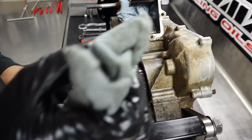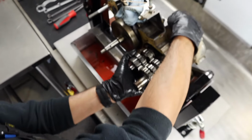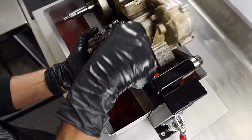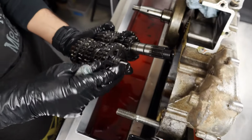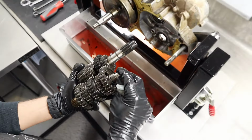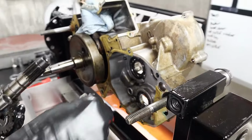It's easier to do a transmission. You just grab the whole thing. Push the shaft on one side, give it a scoop, push the shaft on the other. Hold everything, because they'll fall off. And also, be mindful of washers. Yeah, there'll be washers on that back. There's a washer in there. There's a collar. There's a washer. There she is. Check that bearing. No washer. That guy, good.